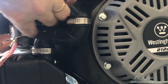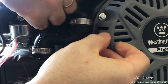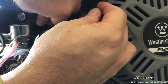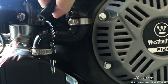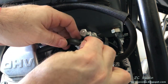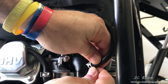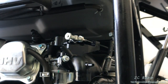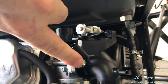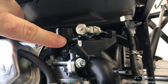With that loosened, I'm able to swing the hose down and out of the way. Moving it out of the way exposes the fuel line coming from the tank. I'll pull the clip back — you could use small pliers to depress the clip to make it easier to slide back — then remove the hose. There'll be some residual fuel in this line, so expect it to come out. Have that jar or a rag ready to catch it. The manifold also has a crank ventilation tube fitting for emissions, and a fuel tank emissions fitting, both of which I remove.